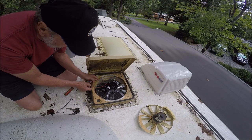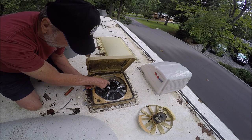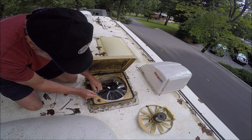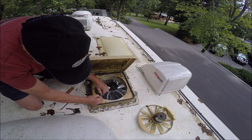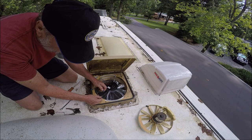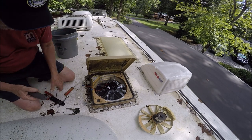Another thing you want to do is have the wires coming out on the correct side. You have plenty of wire. We're going to connect the hot lead of the motor to the hot lead of the coach fan circuit. You need to put this wire in so that it comes up to about this point — you may need to trim a little. You don't want any wire showing past the connector end. This is a one-time-use connector, so make sure it's right before you crimp it. Now you need your stripping tool.